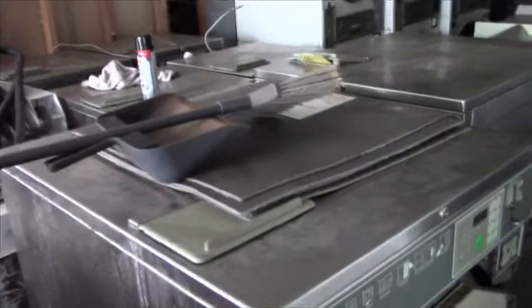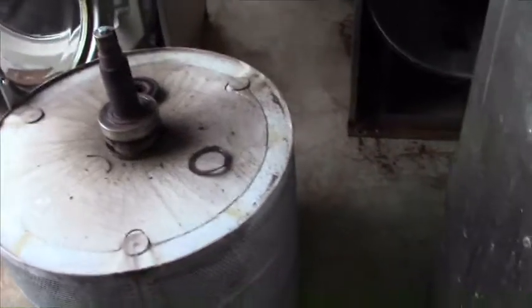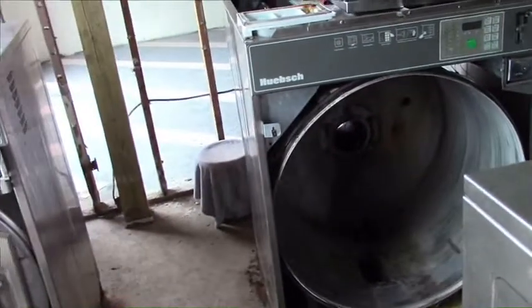So it's been an adventure. Mechanically, there's nothing I can't handle here. A lot of the work is changing the rollers, cleaning it, cleaning out the gas burners and the dryers, changing some water valves, seals, things like that. None of that stuff is a real big problem. This right here, the bearing jobs, that is the big job in these washing machines. But with all my years of experience in taking care of my cars and computer work, yeah, there's nothing scary in these machines for me.